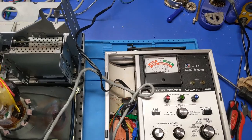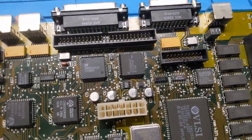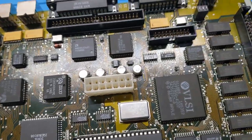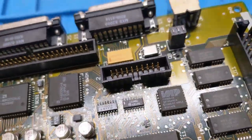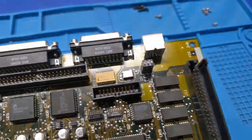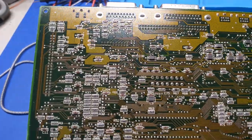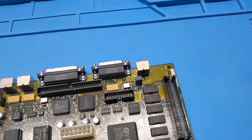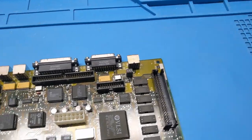I'm going to let this sit a minute and then we're going to start working on the circuit boards. At least the Macintosh Classic is more simplified — there's only two values of capacitors: 47s all across the board, and one microfarad. I should have everything I need to make that work. There's a little bit of corrosion and crustiness in here that needs to be cleaned up, but the big thing is to look in the Molex connector — I don't see any green. So I think a simple wash-down and recap should be fine for this board.